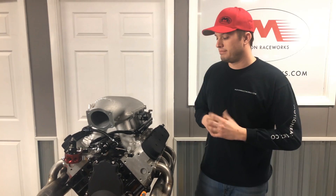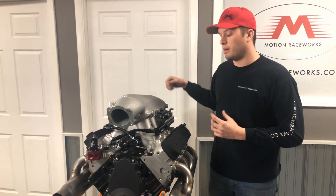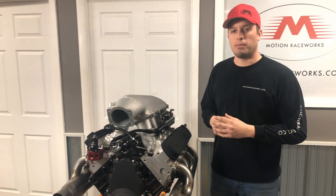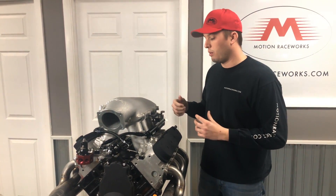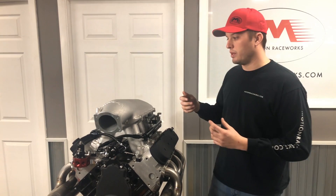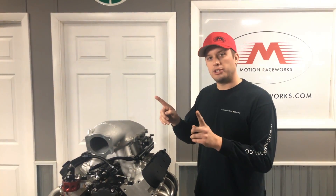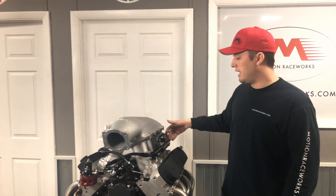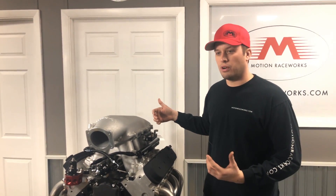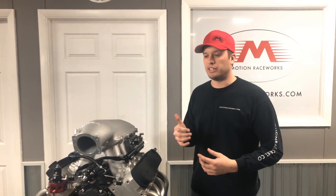For our descriptive purposes, most of our fuel systems use a number 10 or number 8 line coming up from the back of the car from the fuel pump and post-filter. On our combos we always hit them with a Y and split them into two number 6 or two number 8 lines that go into the back of the rails. This is a natural way of hooking lines up so it flows properly and lays out well in the engine bay.